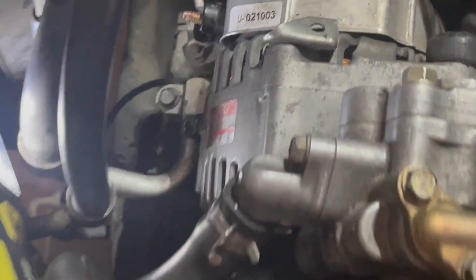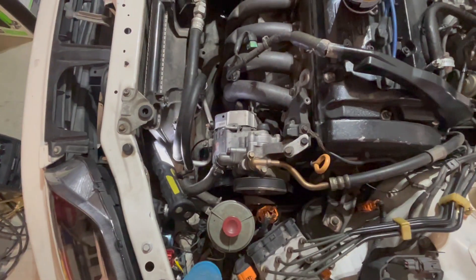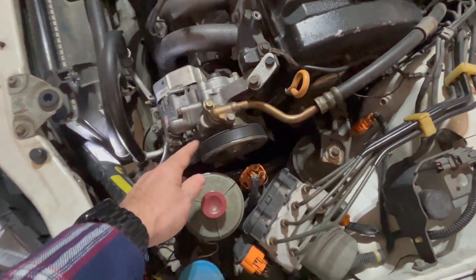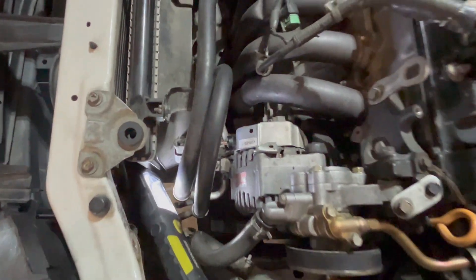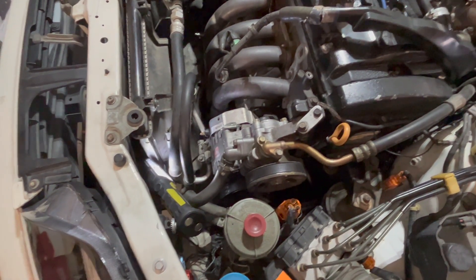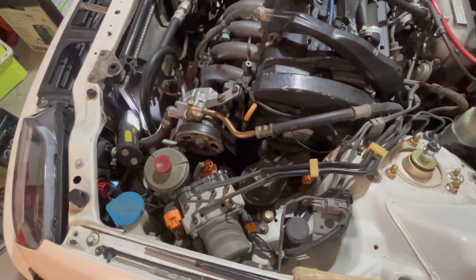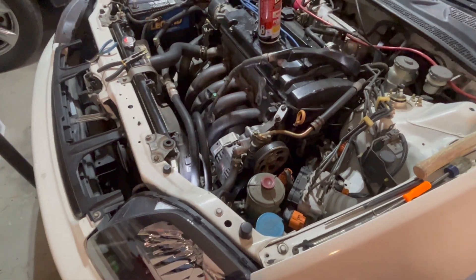There are other ways to do it — you could have welded something to it, but we would have had to take the alternator out. Taking the alternator out was not the best option; we had some bolts here, some bolts underneath, and we had just put these belts on. That's what we were doing — switching out the belts — and that's what we ran into on the way back in. Hope you enjoyed this and hope it was helpful. If you did enjoy it, go ahead and smash that like button. Please subscribe to the channel and smash that notification bell so you'll be the first to know when new videos are dropped. Thanks everybody for watching. See y'all next time.